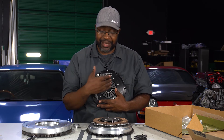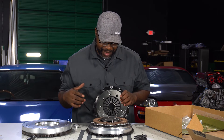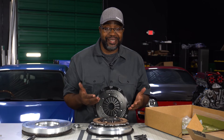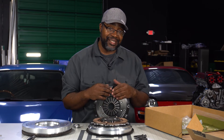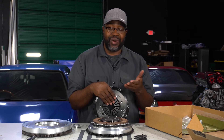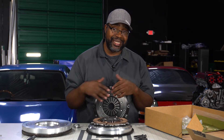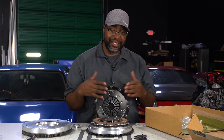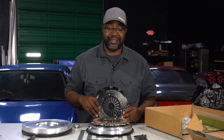You also get the choice between a strapped and unstrapped pressure plate — there's a street pressure plate option and a race pressure plate. If you go all three street — top disc, bottom disc, and street pressure plate — you'll get the most docile twin available, but you sacrifice overall torque capacity. My preferred combo is always the race pressure plate with a street disc and one race disc. This will easily bring guys up to right around 900 horsepower and about 750 lb-ft torque. For a thousand to eleven hundred horsepower, go race, race, race — depending on turbo size, your torque level drops a little at that point anyway, so that combo works just fine.